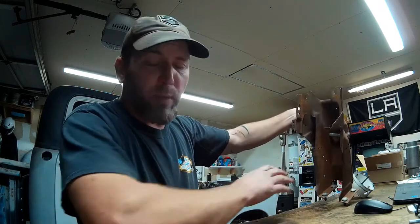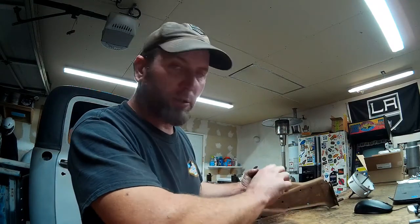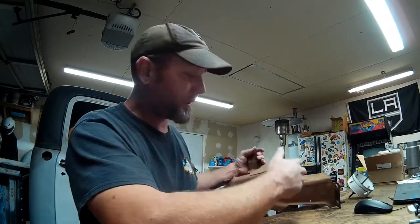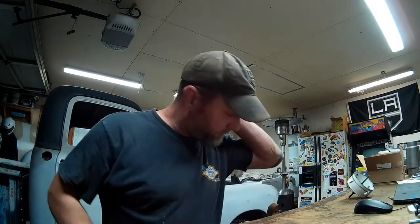Get this mounted up into the dash so it supports the steering column location under the dash and gives us a place to mount our master cylinder. So next week hopefully I'll be on to brakes - get the pedal assembly in place, get the clutch pedal hanging, get the master cylinder mounted up so I can start making and routing our hard brake lines and getting ready to get our flexible lines made up for all four corners. Once we have steering and a braking system, the P48 is going to be ready to move. Once the flywheel is machined, the transmission will go back in for good - we'll put a new throw out bearing in there, a new clutch slave and clutch master I've got to pick up. I'm hoping here in the next couple of weeks that the P48 will be driving under its own power very soon. Thanks for watching guys, if you like the content please click like and subscribe.